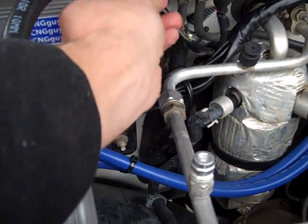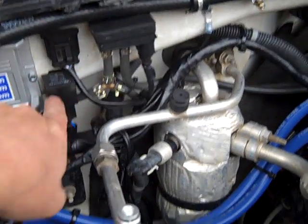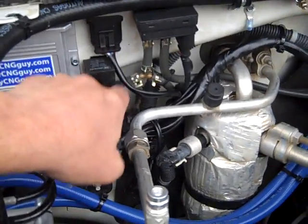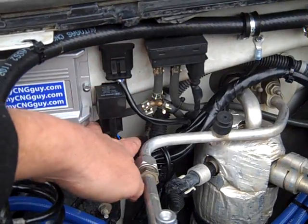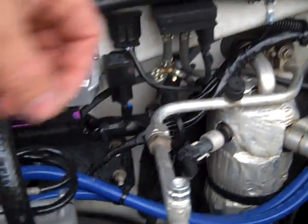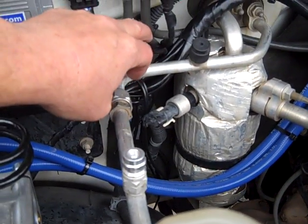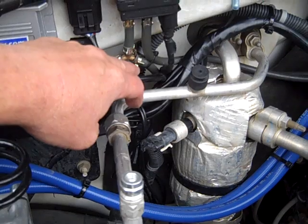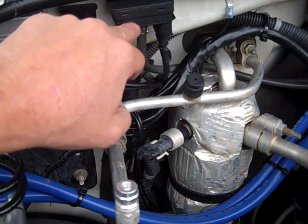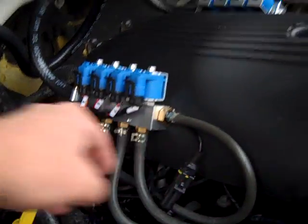Here's our diagnostic wire — I have that Velcro right here. This here is our MAP sensor and this here is one of our relays. In the MAP sensor you have wires that run off this and then tubes. This one T goes directly to our regulator, and then the other tube goes directly to our intake manifold to pull some of the pressure off. That information goes to the MAP sensor, and then this one right here goes directly over to our CNG fuel rail.